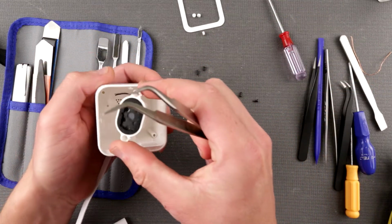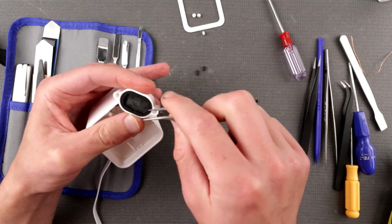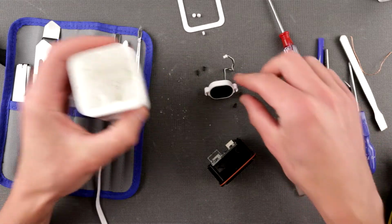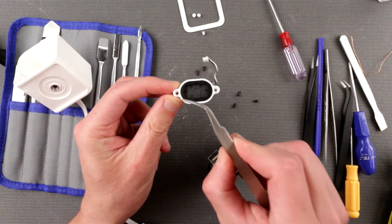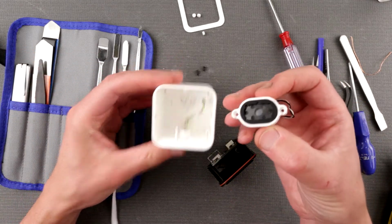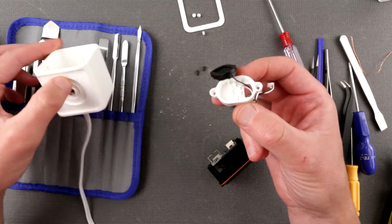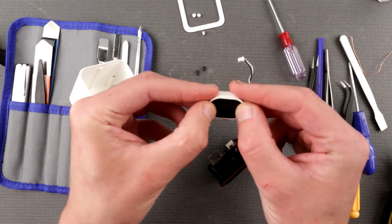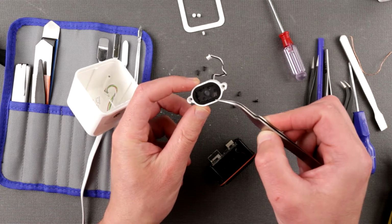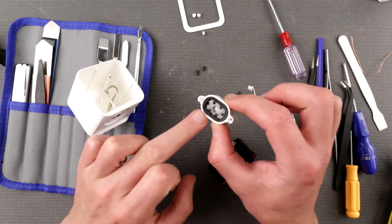I see. What is this? Yes, it is rubber. So this actually is a potential failure point over here, because the gasket is over here, a rubber gasket. It doesn't have any ridge which would press against it. This presses flat against this back, and when it presses flat like that, there is a higher possibility of water getting in. Not getting into the speaker, actually getting around the enclosure. So this is potentially a problematic spot.